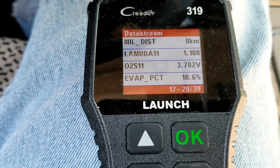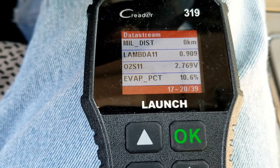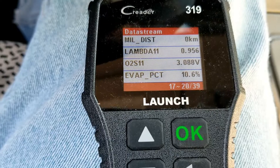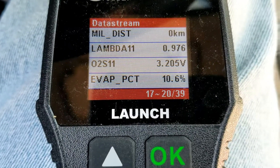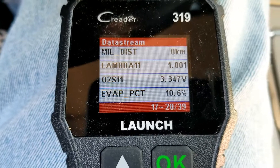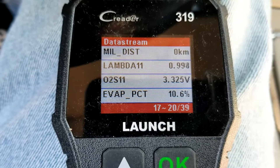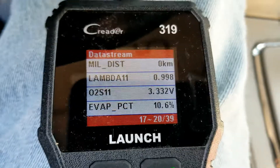I'm going to pump the brakes now. Okay, there it goes — it's going up to around four. Now it should go down into the twos: 2.5, 2.6, 2.9. Now it should come back up right to where it was at 3.3. The sensor is doing what it's supposed to do — it went up, it went down, and then it came back up to its correct position.